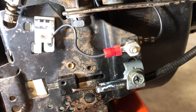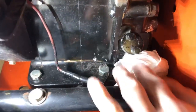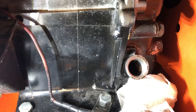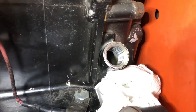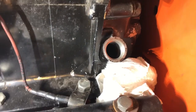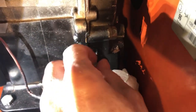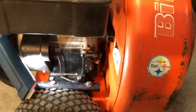Put it in place, start it up, and make sure the switch works. First things first, let's make sure it's still got oil in it — it was fine last year but I've used it, and it works kind of hard. It's down a tad. This engine is working pretty hard running this blower. You actually cannot overspeed this thing, although I don't run it with the throttle wide open — I make sure the governor pulls the throttle plate back slightly. There's enough oil in it to start it, and before I go out and use it I will top it off.